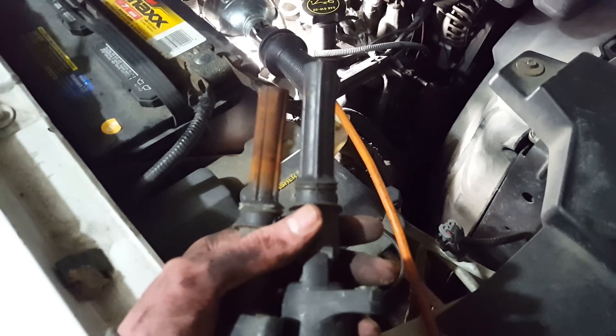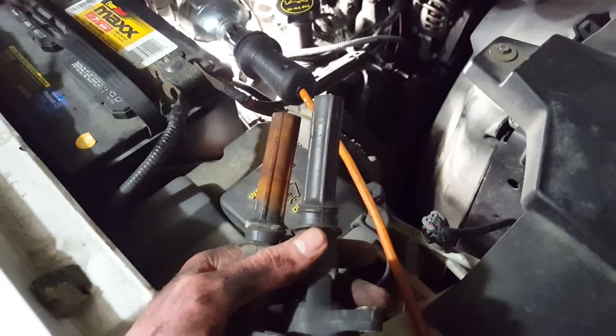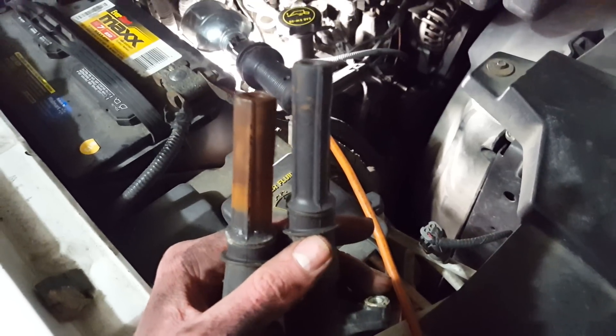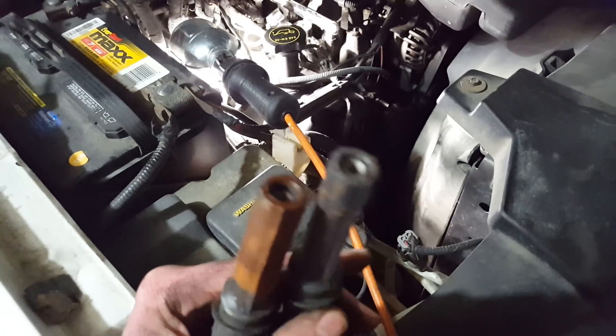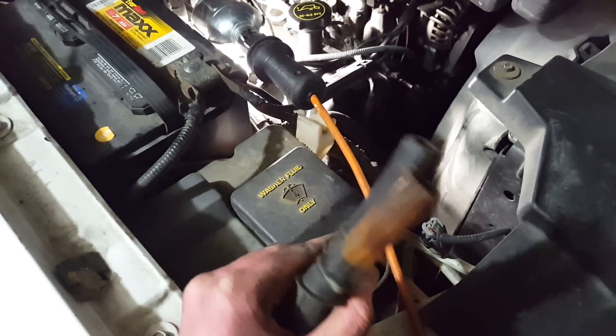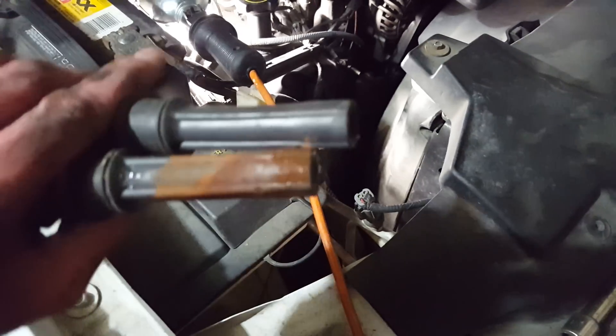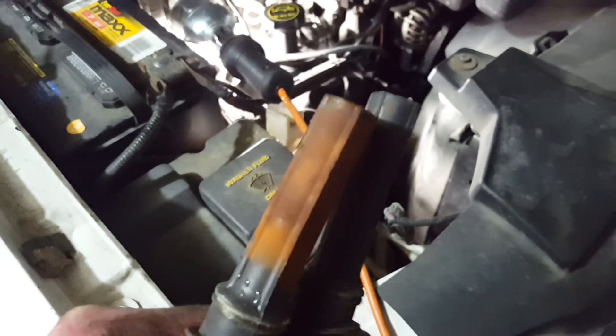Just to show you in comparison, as far as what's a big contributing factor to these misfires: the coil-over plug on my right is the number 2 plug — it didn't have any issues and doesn't look like there's any moisture in there. The one right next to it is the number 3. Obviously, you can see moisture in there; there's a whole bunch of rust, or oxidation, whatever you want to call it.